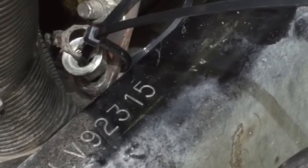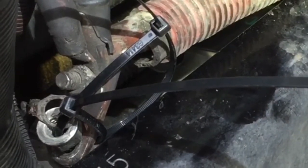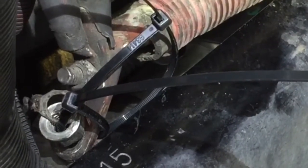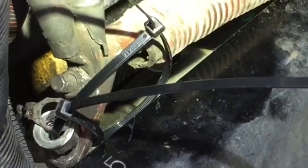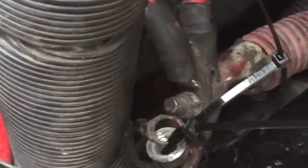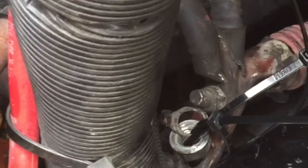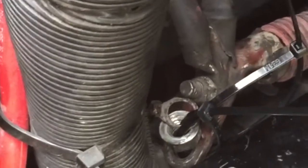Alright, so I just thought I'd show you this. If you're like me, and I've got to drive 85 miles one way to go pick up my starter, you kind of forget sometimes. So as you can see, I've got zip ties on those positive cables coming off the top of the starter. I zip tie the positive together along with the nut that holds them onto the starter. I did the same thing on the bottom where the negative cables come from, because there are 3 main big cables and a smaller one with them, you see that little eyelet right here. But on the bottom, on the negative, there are like 4 or 5 different little cables. So I zip tie them all together along with the nut so that everything is together the way it came off. There's no mixing anything up.